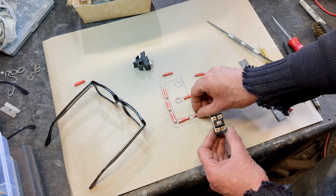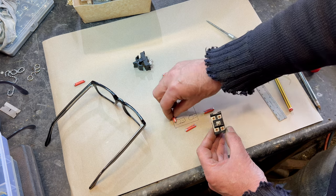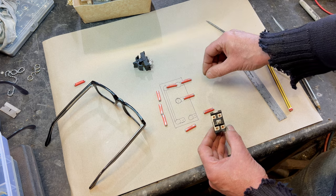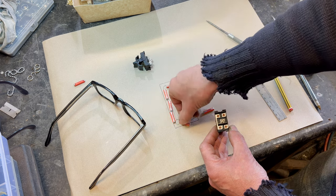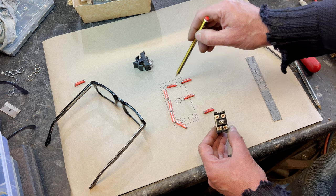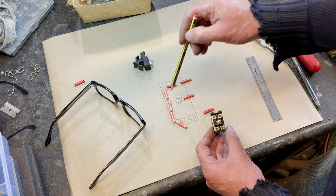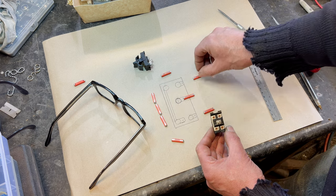So we disconnect it. We undo the switch and put it back to rest, which takes the feed away from there, there, there. Now we bring this one in, so we bring that in there by switching it, which powers that up. What it also will do is send power down here, like that, and that, and that, which will then make that connection there live. So it will be confusing if you're testing this with a test light and you're not looking carefully, because you'll be thinking, well, that's coming live. Now the other side of the switch is coming live. Well, that's why. That's how it works. So when you take that out, disconnect that, that and that and that, all disconnect, and that's fine.